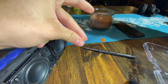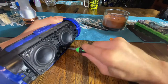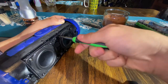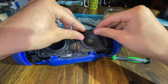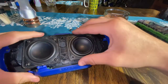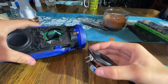Let's go ahead and open this. All right, I have it again. So let's go ahead and remove these screws on my JBL Charge 3. If you do attempt to remove the speakers from your JBL or any waterproof speaker, I am not responsible for any damage you cause to your own stuff — this is not recommended. I'm obviously doing it because I am quite experienced with taking apart stuff. If you have a blown speaker, this is how you replace it: remove all four screws, take out the speaker, remove the leads, grab your new speaker, plug it back in, and screw it back in.